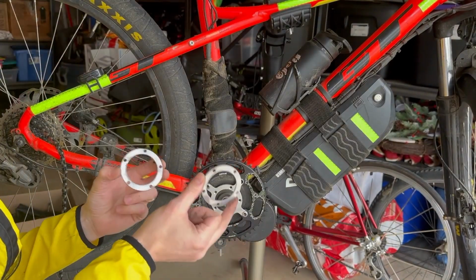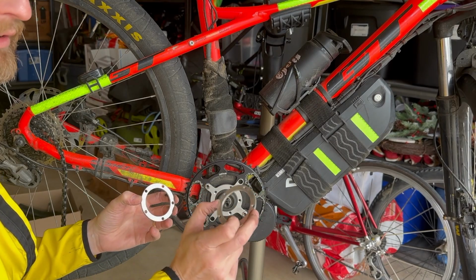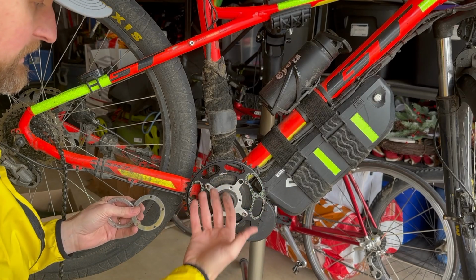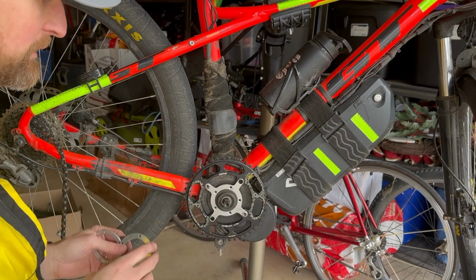Again, I'll have a link in the description if you need to pick up some. These are 3mm Moongate Cycles Bafang spacers, and it will just bring the whole chainring out if you need to fix your chain line to get it improved a little bit away from your chain stays or any other part of your frame.